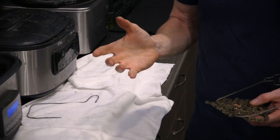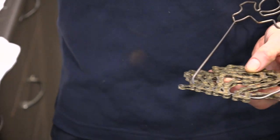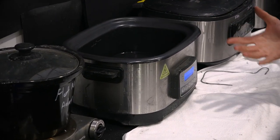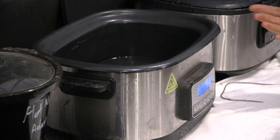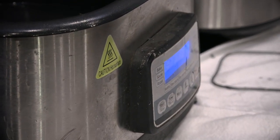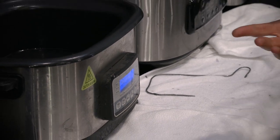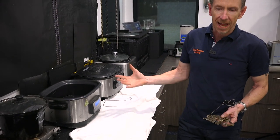The reason why it must be a slow cooker — a common mistake is using a rice cooker. Rice cookers blast heat into the wax almost like a kettle, and the wax doesn't like to be heated that fast. A rice cooker will damage the paraffin base of the wax and basically kill its lubricity. Also, rice cookers heat to 100 degrees then cool down to 60, which is nearly the wax set point, so you bring a whole mess of excess wax out with the chain. A slow cooker on low — you just can't go wrong. You can't overheat the wax with a slow cooker on low. You can forget about it, leave it overnight, go on holidays for a week — it doesn't matter. I've had wax in the slow cooker on low for an entire month of testing, and it doesn't matter how long it's left on. If it's at a happy temperature, it's happy.